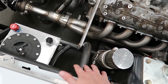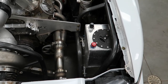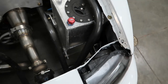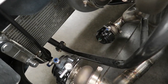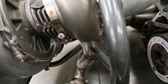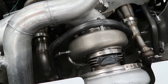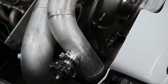First thing was the tube front end — we didn't originally plan on doing this, but we found out while the car was there that the original one was bent up a little bit. So we went ahead and put a new one in, which they completely custom-fabbed themselves. You can see they also did a little cage around the fuel cell to keep that protected. The turbo mount comes off the tube front end, down under the radiator, and there are bolts that make it removable. The GT55 turbo housing has a few mounts on it, and I kind of copied that style from Joseph Young's car.